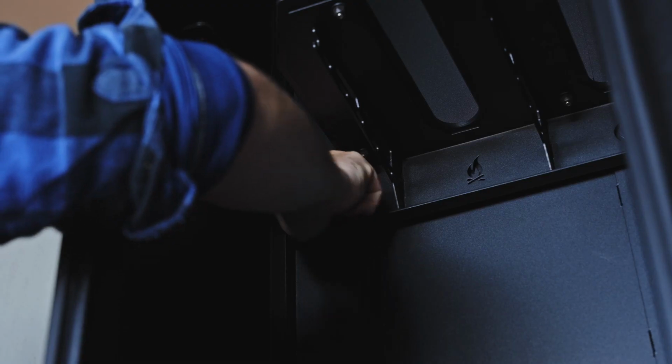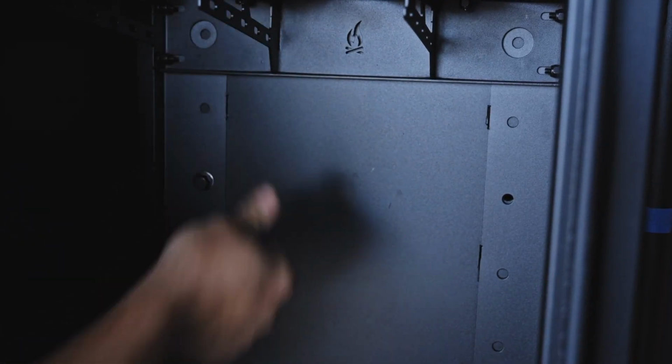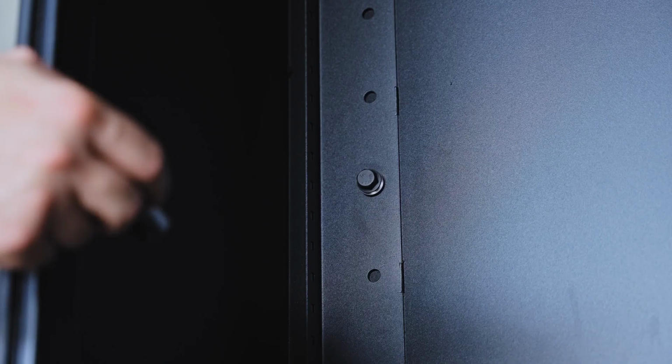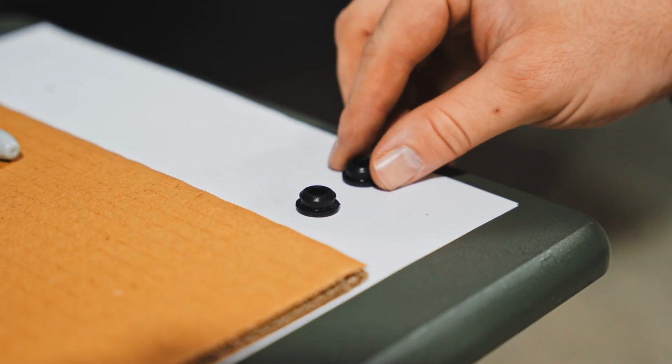Insert the remaining hardware into the upper and lower mounting holes, in the same order as the upper mounting holes, and attach from the rear of the platform using the same order as the middle holes. Once you've installed all 6 of the bolts and mounting hardware, you can double check to make sure the ski locker is level on your platform and tighten the hardware down to 20 foot-pounds. Place the sealing plugs in the drain holes in the bottom of the box tray.